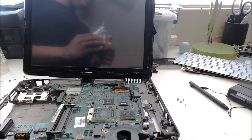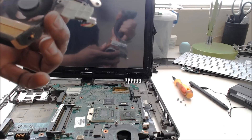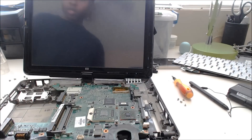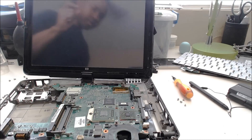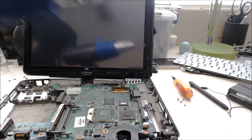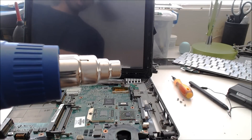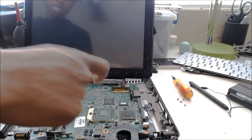This should result in a laptop that is usable and not going to fail. I'm clearing out some more dust from this cooler. So what I'm going to do first is use the heat gun to heat up the GPU. This is just a standard heat gun, nothing really all that special. I'm going to use this to heat up the GPU, but first I'm going to create a heat shield using aluminum foil in order to direct the heat just to the GPU.